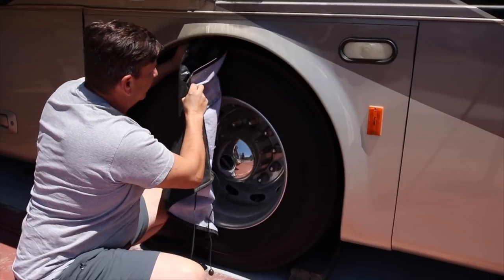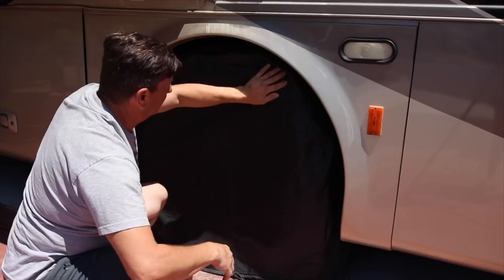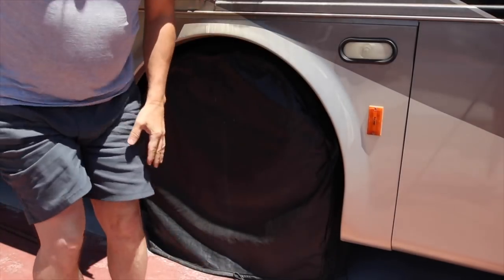This is another safety investment we need to make. You don't want to go down the road with one failing steering tire in the front — that's bad. Also remember that when you store your RV or leave it outside for long periods, you want to protect the tires from UV damage, which can prematurely age them as UV degrades the rubber bonding agents and can cause dry rot. Cover your tires when they're going to be exposed to the sun for extended periods.